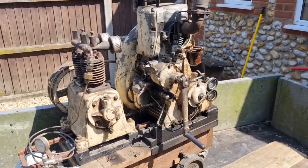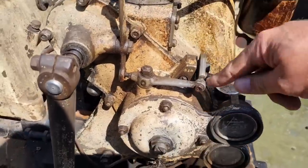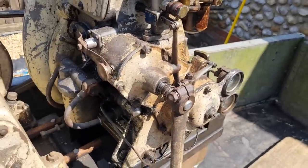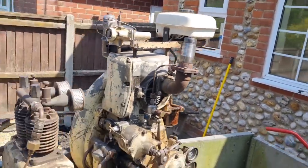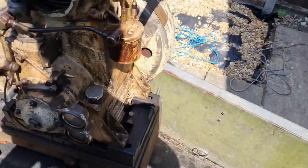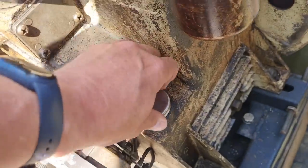These are meant to be notoriously bad starters. I watched a couple of videos last night and people were struggling to start them. We're going to have a go. From what I've seen on a certain video, that's the off position there - apparently we need to turn that all the way so the rack is all the way in. There's our decompress. I think the best thing I can do is hop up on the driver. Remove my little can off the exhaust so I don't fly over the house. Let's check the oil - we might as well. We're on the maximum mark and that oil, you can't even see through it - it looks pretty damn clean, so she won't need a change.